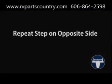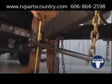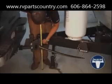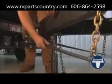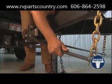Do the same on the other side. Apply weight to towing vehicle. Measure coupler height — it is at 23 inches. We need to get the coupler height to 26 inches. Notice that the spring bars show no flex. This is incorrect; the spring bars need to be flexed.